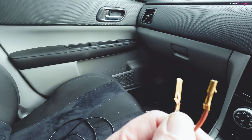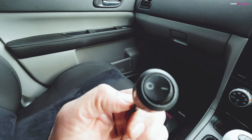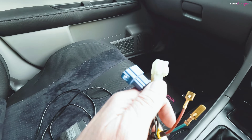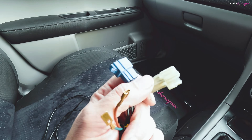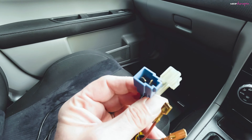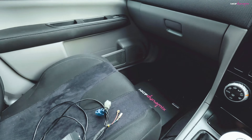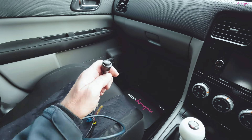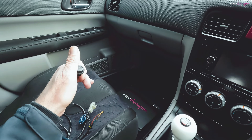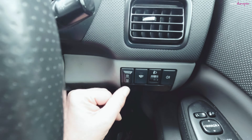Just make up a simple switch with a male and female spade connector and an on/off switch on the other end, so you know when the test mode connectors are joined. These are the extra flash block connectors — the white one is for 2003 to 2005, and the blue one for around 2001 to 2002. If you've got a late Bug Eye I'd recommend getting both just to make sure you've got everything covered. When you're ready to read the ROM out of the ECU, just flick the switch to put it in test mode. You could also mount a switch on the dashboard if you have a spare switch blank.